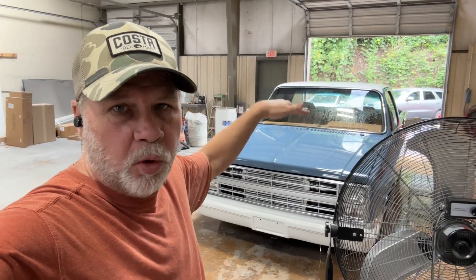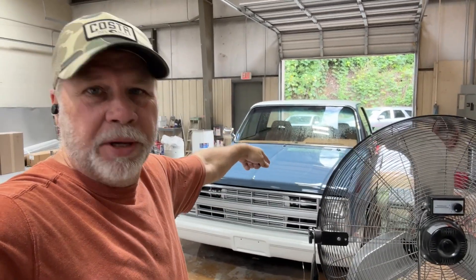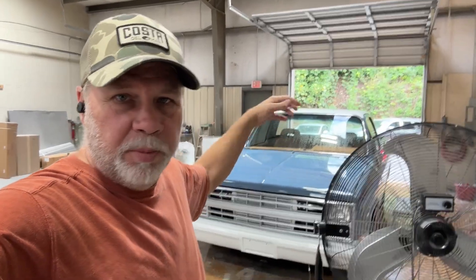There's also more texture than I want on some of the panels. The roof came out really good — it's pretty flat — but some of the other places just aren't as flat as I want them. We're going to buff it out and take care of all that. I'll start on the top and work my way down. I'll do a rough taping and covering of some of the holes like the cowl panel so buffing compound doesn't get in there. We'll do a section at a time — roof first. I'll probably use a DA to sand the roof to knock the top off quickly, and for the rougher texture panels I'll block by hand and wet sand.